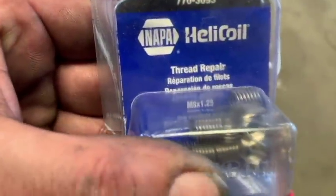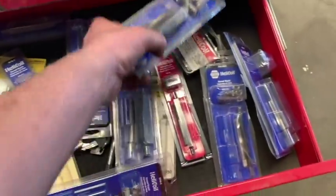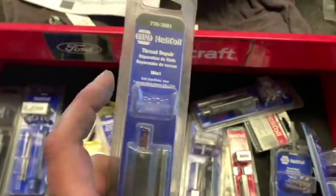So let's get started. Don't you just hate it when that happens - LKQ special. Putting together the cylinder head, half the cam caps were loose, but I got it all put together, getting ready to torque it to spec, and I got two that are no-go's. Now I'm in a situation where I need to get a helicoil. As you can see, we've used them all, so I have to wait for new ones to come in.